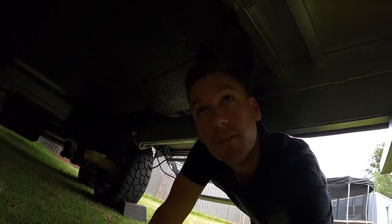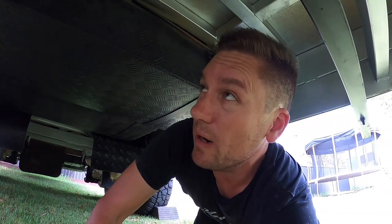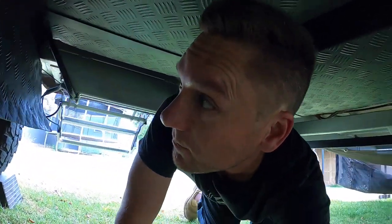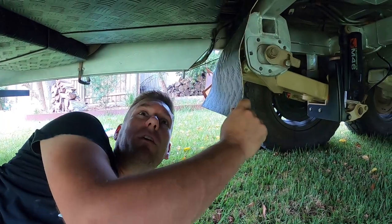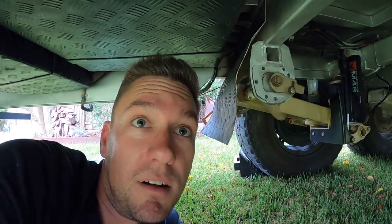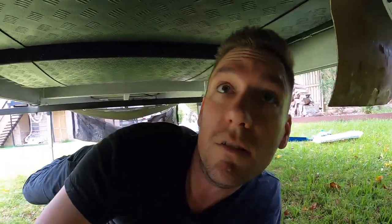Another thing I've been doing is climbing underneath and zip-tying things that are loose. I've probably put about 30 zip ties under here — just securing loose cabling, because it rubs on stuff or can get caught and pull off. Making sure all your wiring and water lines are tight. I also found a suspension guard — they protect your suspension from rocks. This one's okay, but the other one's only got one bolt in it so it's just sitting there rattling around, so I'll tidy that up.